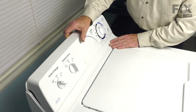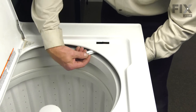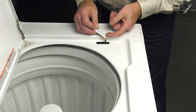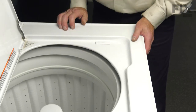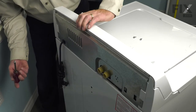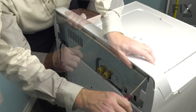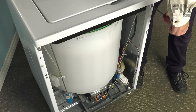We'll then secure that console to the back panel with the three-quarter inch hex head screws. Next, we'll need to reinstall that lid switch. Make sure that the side that has the spring-type clip on it faces towards the back of the washer. We're just going to fit that up through the opening and you'll see a little slot on the front side that will slide it down into place, push it forward and then snap it into place. We'll then secure the top panel to the cabinet with two screws through the front. Just make sure that back panel is tucked in underneath the top edge of the console. Let the screw holes line up and then just install them and tighten them securely. Just make sure the brackets line up with the holes in the cabinet and install the two screws.